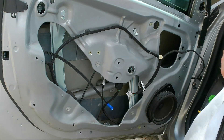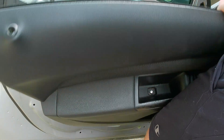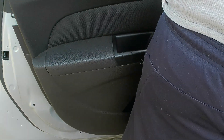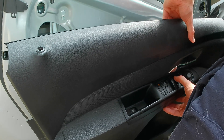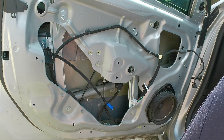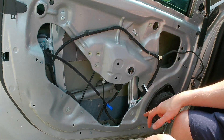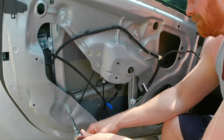Since the window is up here, I need to drop those tabs down a little bit. I'll re-plug in the door panel controls, key in the ignition, move the window down, then unplug the door panel again and set it aside. Now you have bolt, bolt, bolt, bolt, bolt, and bolt — they all need to come out.